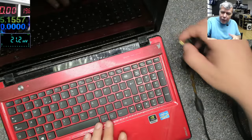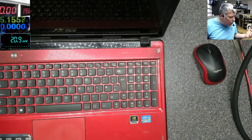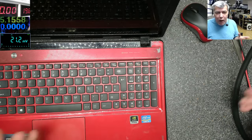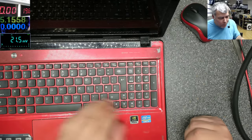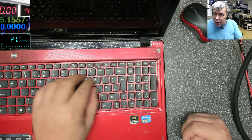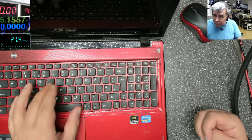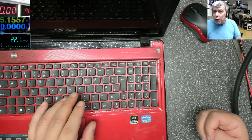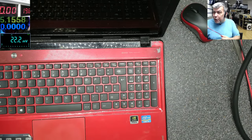So how do we check? First, I want to see a reaction from the computer when I press the power button. Usually, if you have a motherboard fault or a good laptop, you see a reaction when you press the power button — but not always. If the motherboard is faulty, you won't see a reaction on the current. I'll check with the power supply. You have to see what the current is doing. You won't see a reaction when you press the power button, but you will see that 3.3V power supply drawing around 10-15 milliamps, because that 3.3V power supply and the super IO together are always on. So you'll know if it's a motherboard fault or a charging port — if it's taking no power at all, it is the charging port.